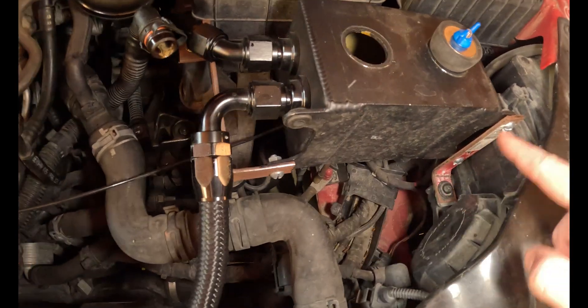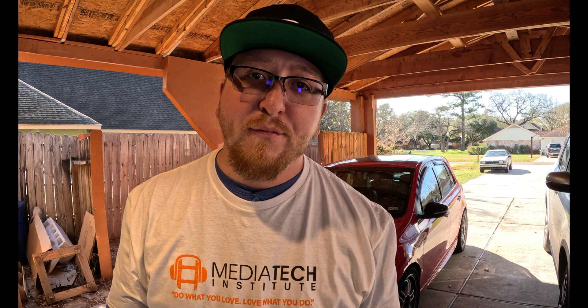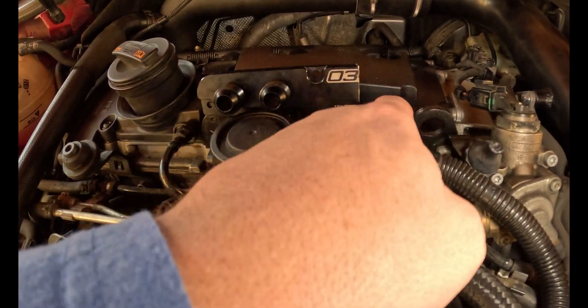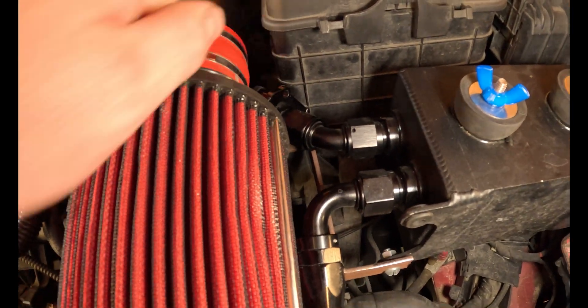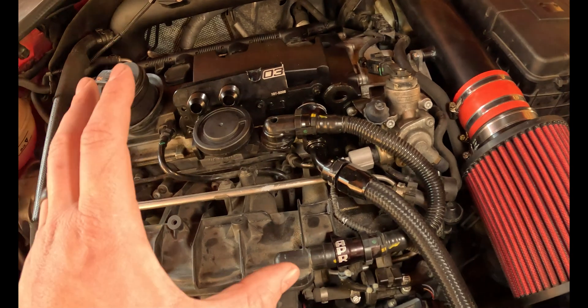It's also working better — I have other buddies with VWs and GTIs that got the Airtec plate and the little built-in kit with the smallish can, and they still had massive blow-by issues even at autocross. As you can see, I did have to come up with some custom brackets — steel bar that I measured and bent — holding this can pretty sturdy. With a little bit of engineering and some measurements you can build a much cheaper can that in my opinion is working much better than the ones offered off the shelf. Now if you don't want to go through the hassle of keeping the stock PCV valve, you can ditch it, run this plate, and then run your two lines off of the plate to the can with two filters as well — the plate replaces your PCV valve, with the big one-inch right here coming from the block. I hope you guys enjoyed the video — I did do a custom intake to complement this catch can as well. Make sure you subscribe, like, and follow along for future videos. Y'all have a good one, peace out.